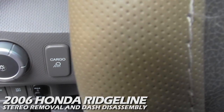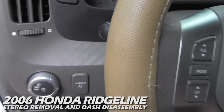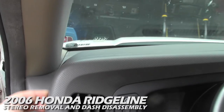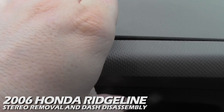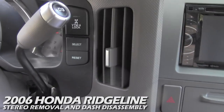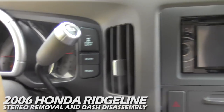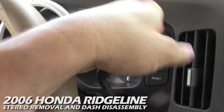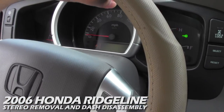Turn the key off and take the key out so there's no power going to these switches. You're supposed to disconnect the battery — for practice purposes, when you do this, disconnect your battery. What I do is put my fingers around the back of the panel and slowly pull, working my way around. It'll slowly release. Once it's basically loose, stick your key in the ignition — this is an important step — turn the key to on, put your foot on the brake, put it into third gear to get the shifter out of the way.